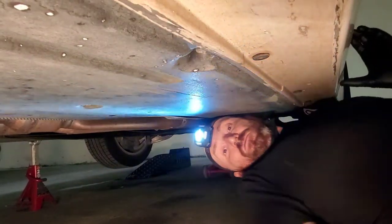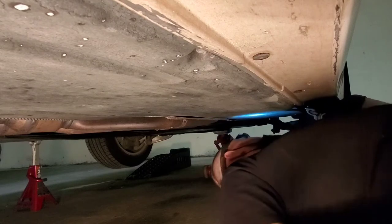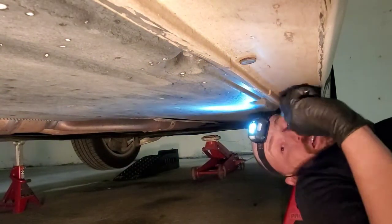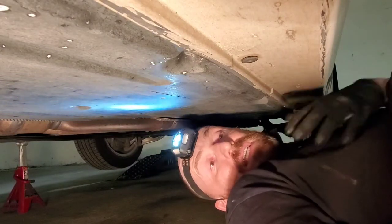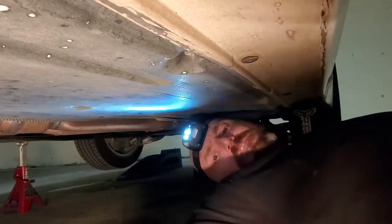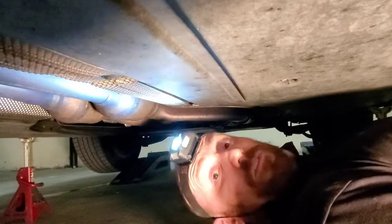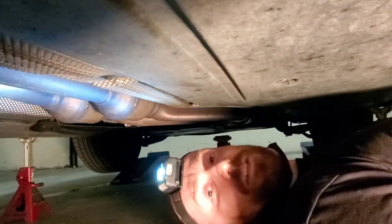Hello! I'm coming to you from underneath my BMW E60 — well, this is an E61 but it'll be an E60 — E61 five series. What I'm going to be doing today, showing you how to do and learning myself how to do, is a major transmission service. I'm going to change the solenoids and change the valve body seals, and hopefully that fixes it — it kind of shifts rough and I have the 2-3 clunk, so when the transmission gets really hot it goes clunk when it shifts from third to second.